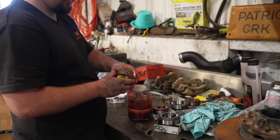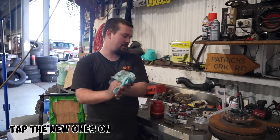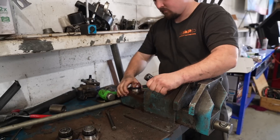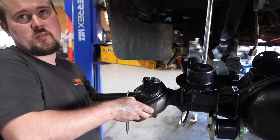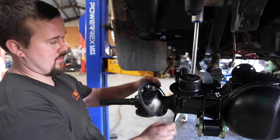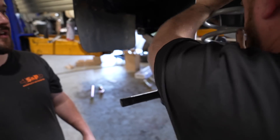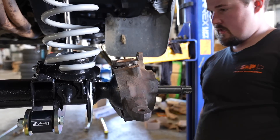Just packing the wheel bearings at the same time here — I'll just do all of them. Inner, outer, kingpin — couple done there. Chisel the old ones off, tap the new ones on. Make sure you put these on before you put the housing on — in the right order. On these ones: metal, rubber, and then the dust seal at the back. You just tuck them over. Once they're greased, that's all the grease they get for their life. And in goes the spring. See the knuckle just slides back over, and then the kingpins hold it on.